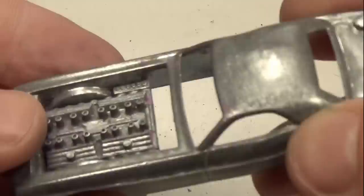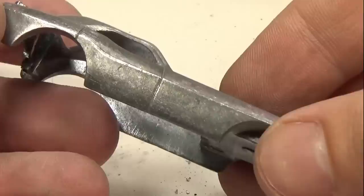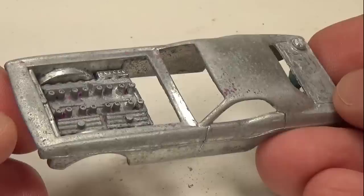Here's what the body looks like after all the paint was removed. Looking it over, there is quite a lot of oxidation and pitting. I'll go ahead and remove the oxidation with the electro-polishing setup — link below if you're interested in that. After the oxidation was removed, the pitting really stands out, especially in the rear of the car. I wasn't sure at this point if I was actually going to be able to restore this car, but I decided to carry on and see what could be done.